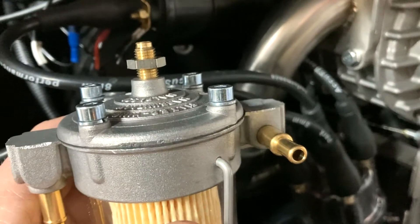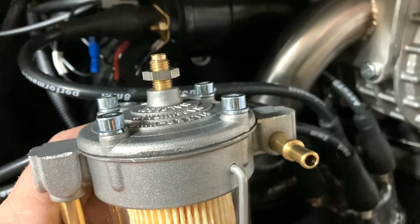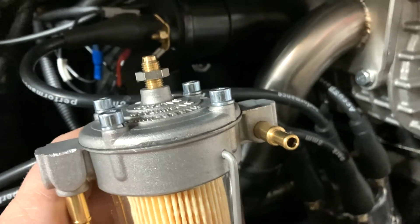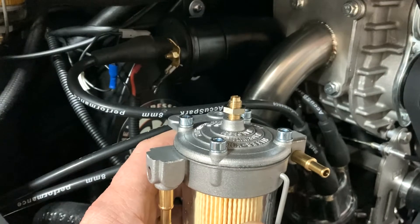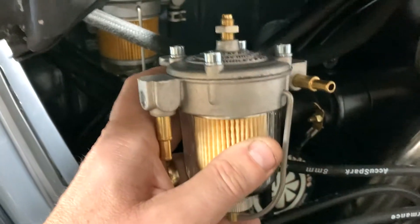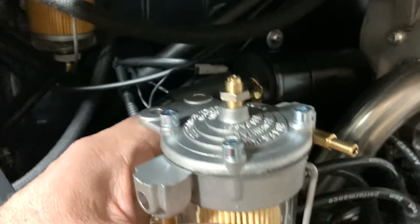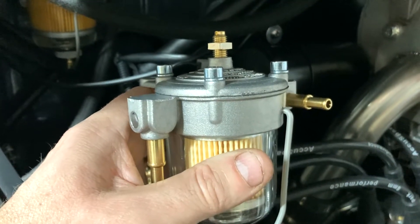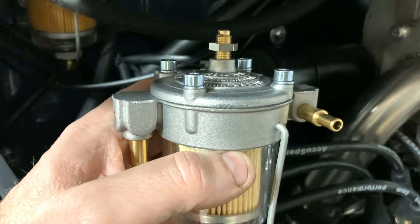In theory, even if you get down to 1 psi of pressure, through the 8mm fuel pipe that will provide 2.4 gallons a minute, which should be more than enough. Even if you were travelling at 100 miles an hour at 10 mpg, you would only need a gallon every six minutes or so. The fuel pump is always going to be pumping at 3 psi and filling your bowl up, so reducing your pressure to as low as 1 psi just replicates what's happening on the motorcycle - the carburetor is designed to be fed by gravity.